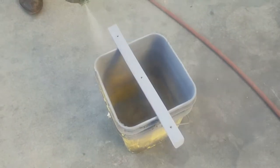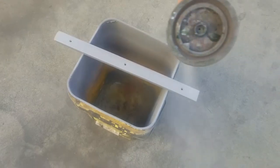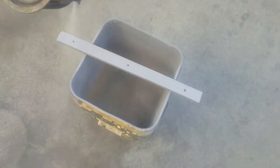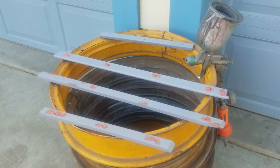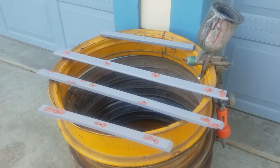Here we are for a second time around. Each one of the pieces required at least two rounds of primer surfacer. If they were good enough on the second shot, there's no sanding in between — we go directly to the color. If they're not good enough, we did three or four times. Sometimes some additional red filler is used wherever we have minor flaws.